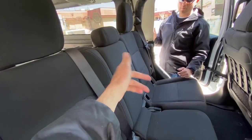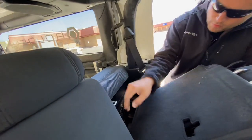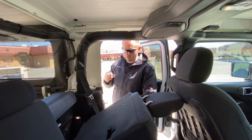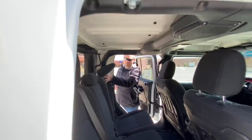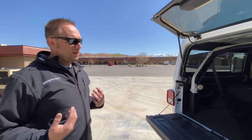Craig, did you keep the bulkhead behind the rear seats here? We did. Originally the plan was to cut them out to access that space, but you can see the actual tethers for the seats are right here. Gaining that extra four inches of crawl-over space didn't seem important enough when I had to think about where to cut and recut the bed and then remount the seats. I decided: the kids are small, they can just climb over. This seat bracket is also removable — it's actually a bolt-in bracket from TeraFlex designed for the JK. We modified it so it can fit the JL seats. They don't sell it for the JL, but a little modification and we made it work.